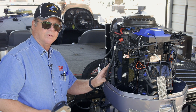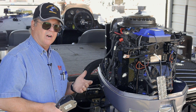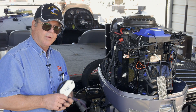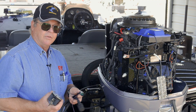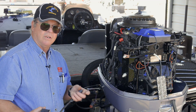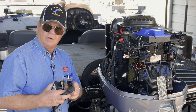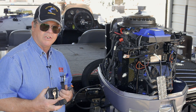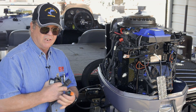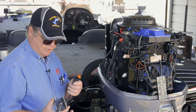To eliminate a problem in the boat side harness itself causing the engine to misfire or not even fire at all, we have to disconnect it and use a remote starter that enables us to control the engine back here. This one is made with two different options. This older connector connects to the old red harnesses on the engine, and this one is for 1996–2017 Deutsch connectors on the Johnson and Evinrude motors.